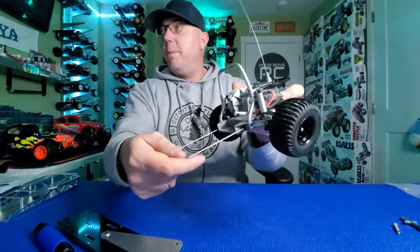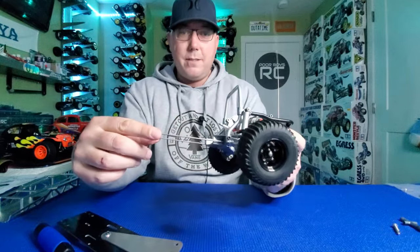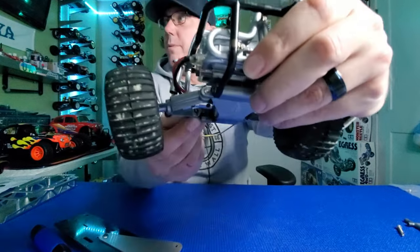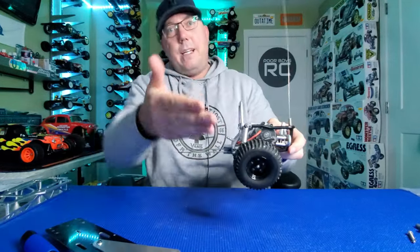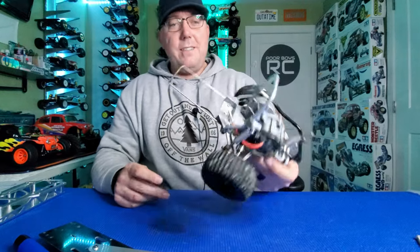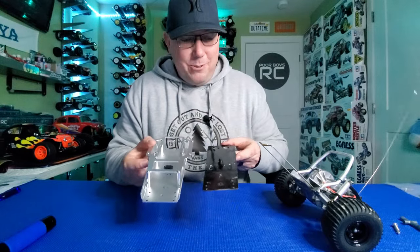What the heck this little bar here is all about and why that's hanging out — really neat. It's actually like a torsion bar type of suspension system. This is the exact same thing and it works in conjunction with the rear lower A-arms right here, so as the suspension compresses it twists that torsion bar and provides more suspension dampening, which is kind of a neat design. Super super antiquated but very cool.